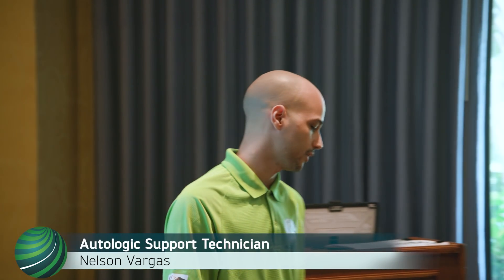I also have some extras in here — a couple of things I picked up working at Autologic. There are companies that allow you to code DMEs from another used vehicle, remove EWS out of an E46, just weird stuff like that. Sometimes customers come in with race cars and want to remove certain things or put used parts in cars. Usually with ISTA you can't do it, but these companies allow you to send them the part or even remotely program it.